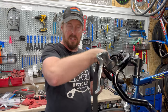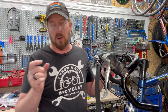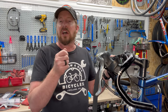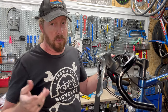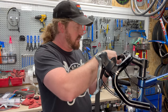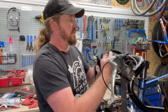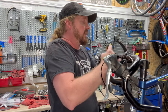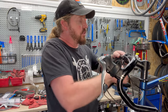You're keeping a taut tension on it the whole time, kind of stretching it a little bit. If you're worried about breaking it, always take a little piece and see — if you haven't wrapped before, take a small section and kind of tug it to see how far it goes until it breaks. It usually has excess, especially on smaller bars. If you have really big bars like 44 centimeters across, then you're going to need every centimeter of that tape. As you can see, it's nicely wrapping over that extra piece of housing to give it more of a round effect so it doesn't have that internal gap.